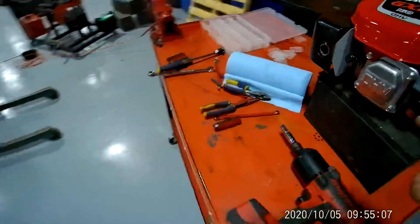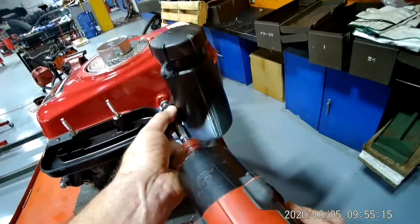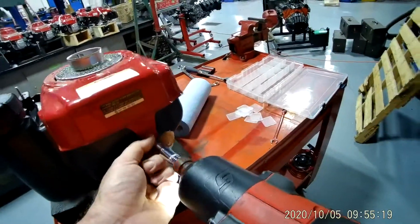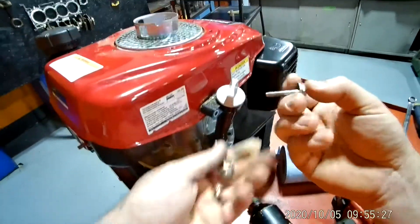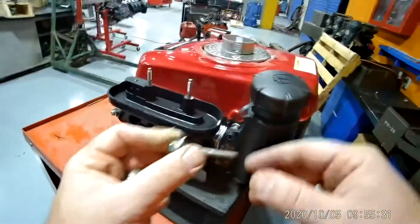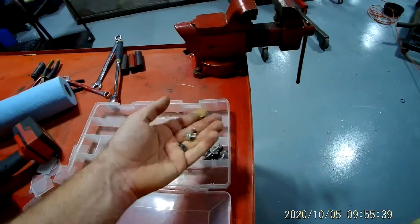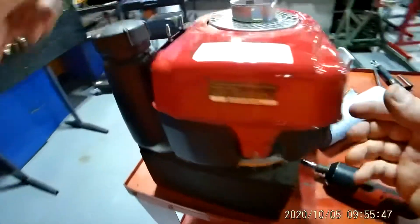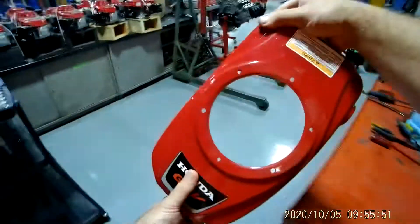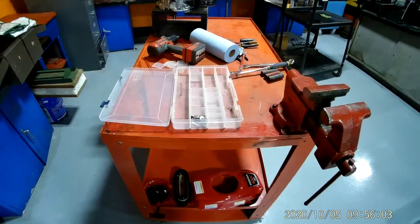Now I want to get this cover off. I'm going to start at the front here — this is a 10mm. Take that 10mm off. There is a 10mm bolt here, a 10mm nut here, and one holding the dipstick tube on. The one that holds the dipstick tube on is that long, and the one that holds the fuel tank on is that long — so there is a difference in length, and they both have washers. Now that I have done that, this should lift off. This is the order I take things apart, so if you reverse the order, that is how you put it back together.